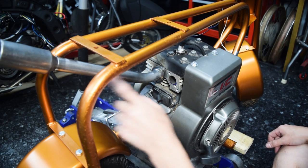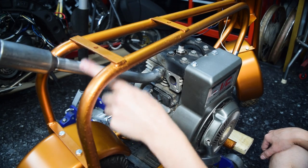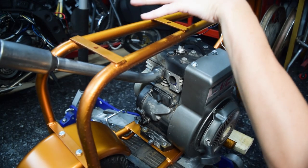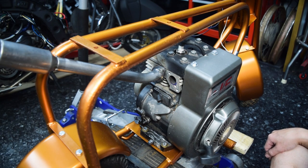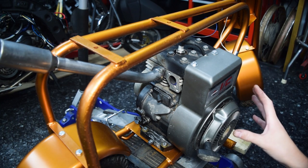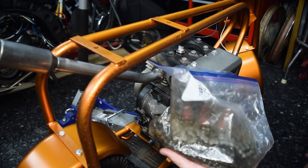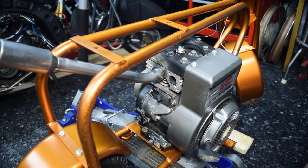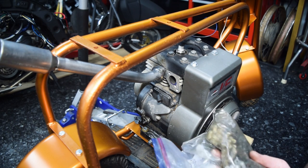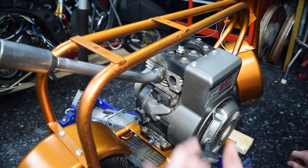This is the exhaust I'm going to use — it actually works really well. Since I'm going to be making a seat, I can dictate if this exhaust is going to be too close or not, so we're going to have a small seat, kind of forward more. I might cut this once just to get it angled down a little bit. The engine is in its home position and the wheel is in its final position, so I can now figure out what chain we're going to use. Being that we're doing a parts bin build, I have to go through my bag of scrap pieces of 35 chain — every time you work with chain you don't ever have the precise amount you need, so you always have extra, and I keep all the extra.